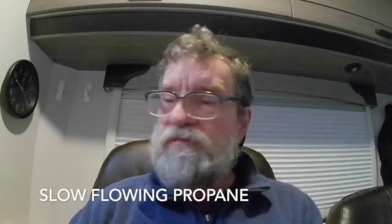Extreme weather, another problem with that is that the propane stops flowing when it gets really cold. Okay? Now, when we're driving our truck, our truck burns propane. When it's minus 28 Celsius, no, can't use propane anymore. It just shuts off because it says, okay, I'm not getting enough propane, and that's it. You got to go back to burning gasoline, which is fine at cold weather. So that's not a problem.